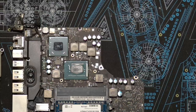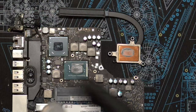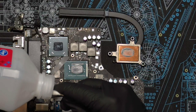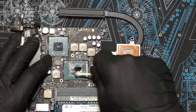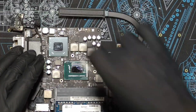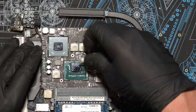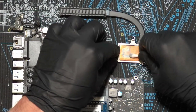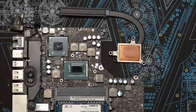I had actually recently reapplied the thermal paste, so mine's wet. If you've never done this before, odds are your thermal paste will be very dry. Take your Q-tips and isopropyl alcohol — I stick mine in the little hole and squeeze to get the Q-tip wet — and wipe the thermal paste off the processor die. The metal, shiny part of the processor is what we're really concerned about; that's the part that gets really hot and needs the thermal paste. Get it as clean as you can, and then also clean off the heat sink.